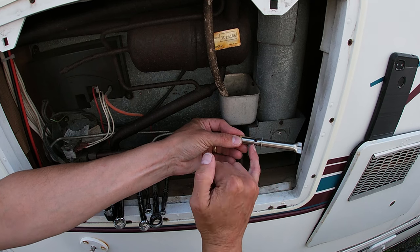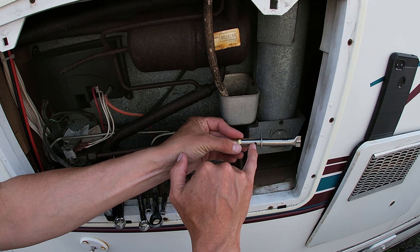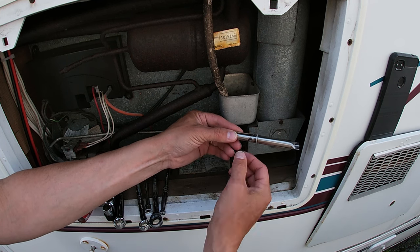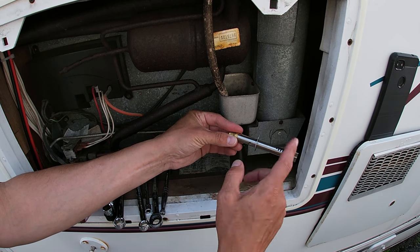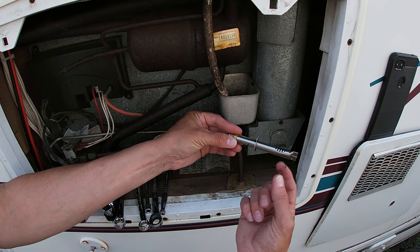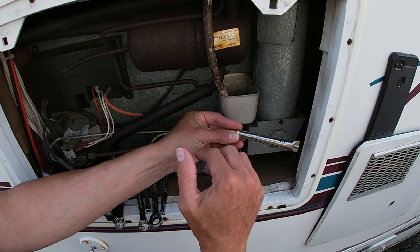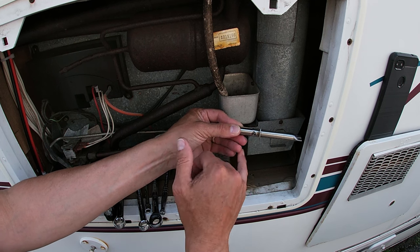The common problems with these are you get a bug in there. Any sort of bug that covers one of these holes will change the oxygenation for your propane and will make your propane fridge burn really bad. You could have a very cold flame — it's still burning, but really cold because there's not enough oxygen to produce the heat needed with that tiny amount of fuel. Without enough flame, you won't get enough cooling or heating cycle in your fridge, and your fridge doesn't work very well. It could be only because there's a bug in there. Something as simple as that.